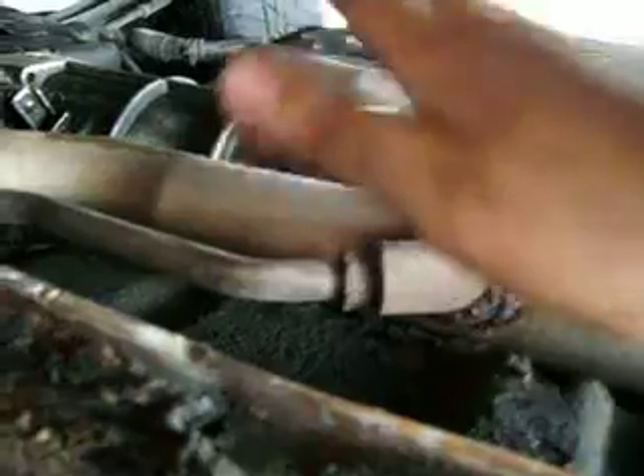This is your exhaust, and this is where the AIVs basically freshen up the exhaust system — but it can just be taken out. What I'm going to do today is drop the exhaust, cut these open, then weld a little spot on them to get rid of the tubes. As you can see, this is not the stock exhaust anymore — it's been custom made, two and a half inch.